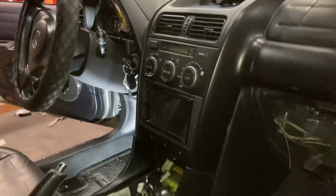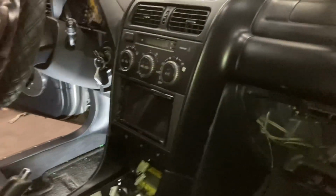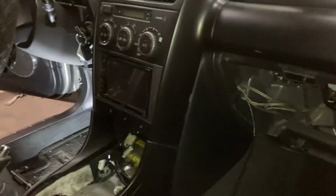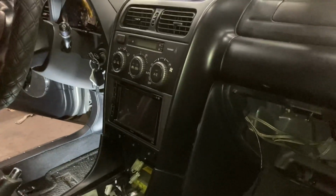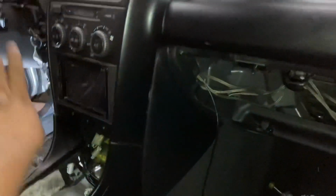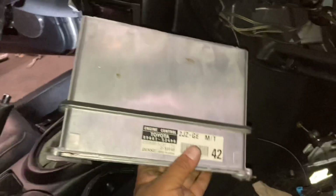Now, instead of keeping the factory ECU here, I'm going to move it over underneath the dash. Thank you to my buddy Q with his D-Zod harness. I saw he was able to tuck it up and in there. Pretty cool idea for something you're not going to touch again. On his car it was the AEM V2 in there, which I didn't really like. I think the V2 should have stayed over here. But in this car, since I got to build the harness, I'm going to run these up to the side and tuck the ECU up against the firewall over there. We're never going to touch the stock computer again anyway, so this is just going to go up and in. Let's get this together, guys.